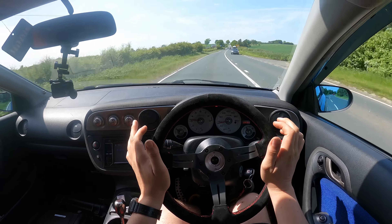Just putting the roll bars back on. The car had three quarters of a tank of fuel by the way — it weighs 1,230kg with three quarters of a tank, so call it 1,200 dry. That's pretty good. Right, so we'll get the wheels back on and we'll set some camber.